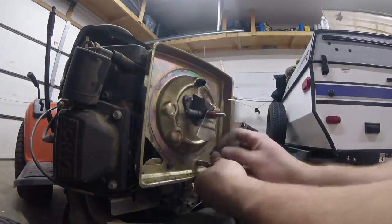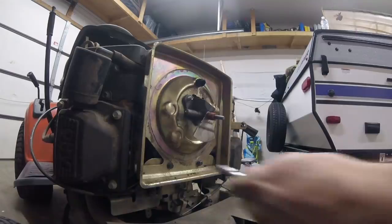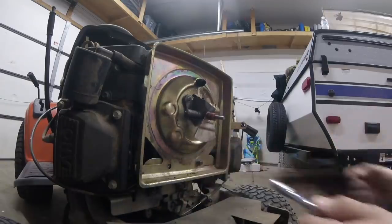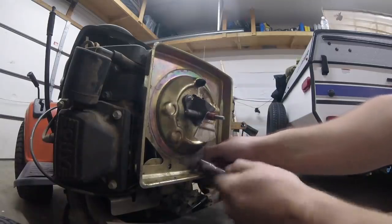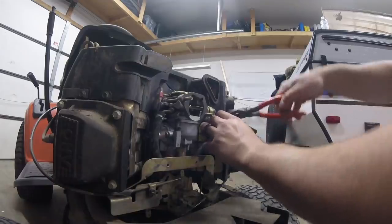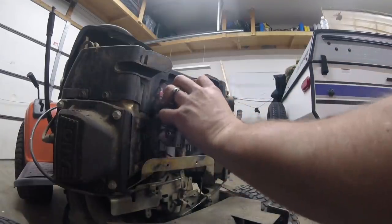Dad told me that it was either this machine or possibly the boat, but he was trying to drain the rotten fuel out of the carb. And the little nut broke off the bottom. And I don't know, it didn't seem like it was this, but now that I'm in here, these bolts do seem kind of looser than they should be. Got the fuel in from this side. This little plastic box here, this is the fuel pump. Looks dry.